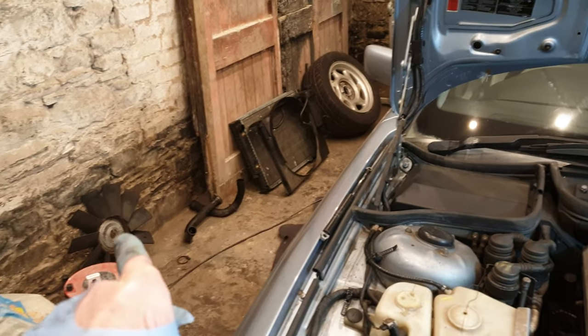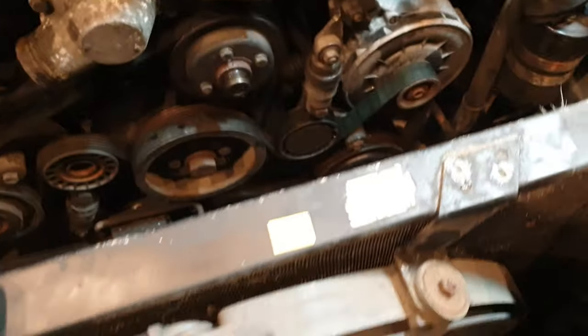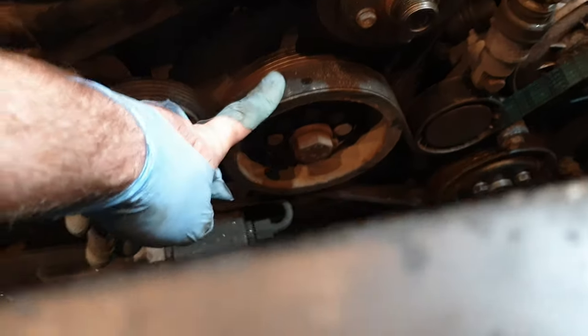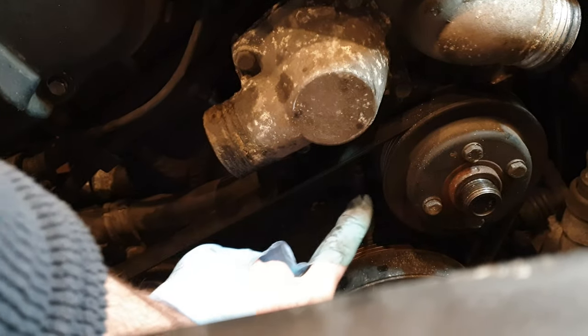So that's the radiator removed. We got the fan shroud removed, and we have the fan clutch, some hoses removed. And that gives so much room for activities. The condenser is actually in pretty good condition, but I'll obviously have to do a test to see if it's airtight or gas tight. And then I'm going to be cutting these belts off, and I need to remove the vibration damper to actually get at the lower water pump bolts, which are underneath here. So let's do that now.